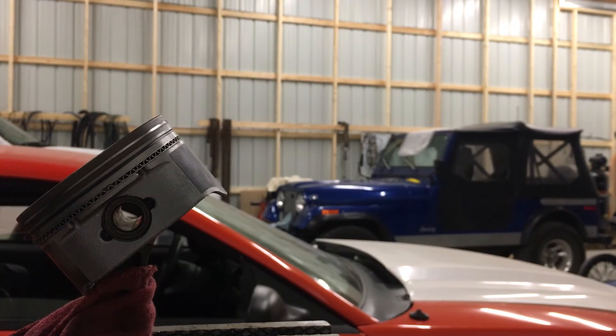On this particular motor, after I honed it out I made a mistake — I went ahead and fitted my rings in the block first, then used a hone to hone it out myself. I didn't think I'd take out much, but I took out enough to where the ring gaps are about a thousandth or so off. I ended up at about 28 thousandths, and I gapped the bottom one a little bit more just to match 28, so both of them are at 28 thousandths. We'll see how that does with the boost.